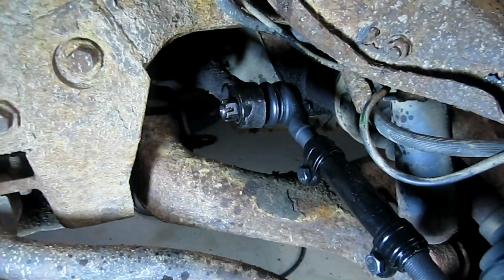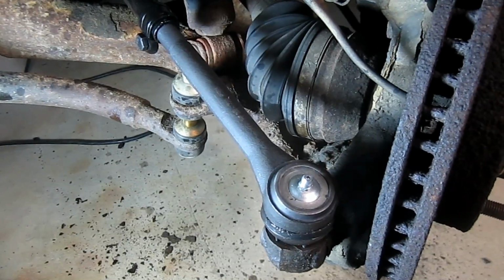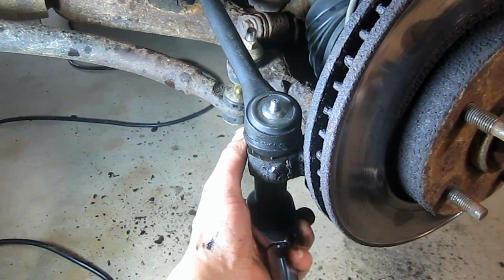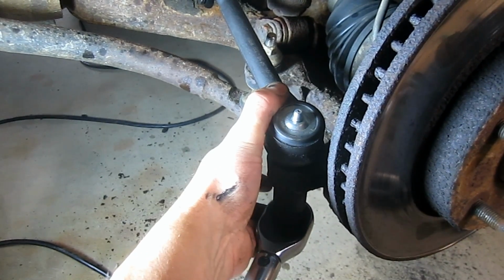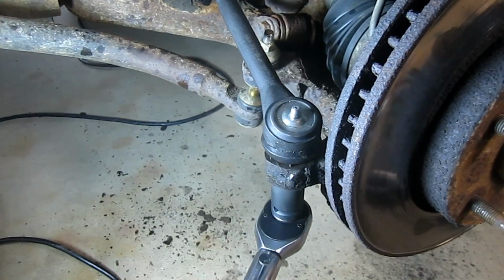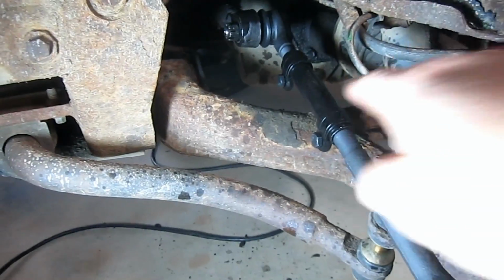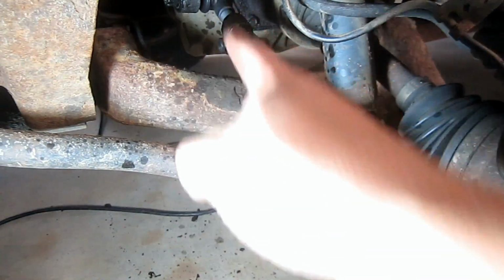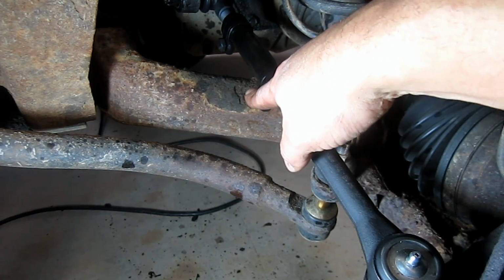That's it. Okay. Now what I'm going to do is straighten out the wheel just so I can get this in at a more vertical angle before I crank it down. Okay, according to the torque spec site that I have, sent to me by a subscriber, Jamie Sarkeesian, thank you, 39 foot-pounds for this outer tie rod end. Okay, that's it. Now I'm going to torque the bolts on the adjustment sleeve, and those are 16 foot-pounds. Incidentally, both of the nuts on this new tie rod end, inner and outer, are both 18 millimeter. Okay, and on the adjustment sleeve, we're looking at a 13 and a 12.